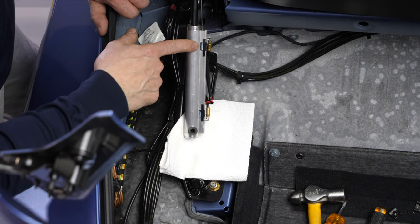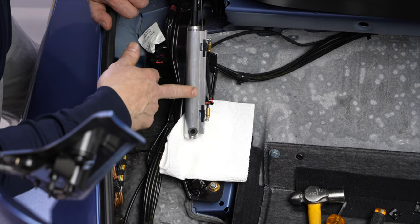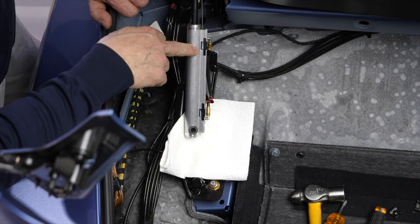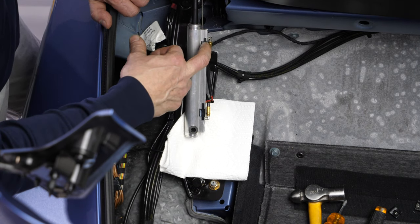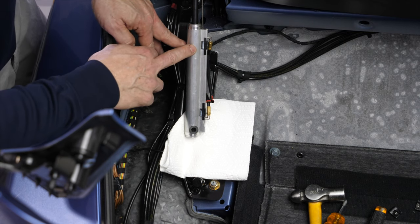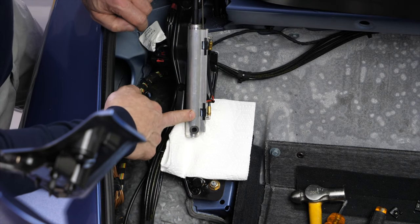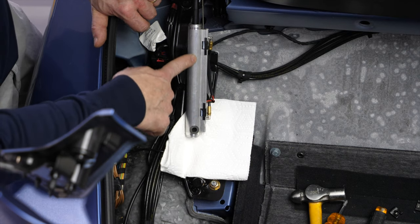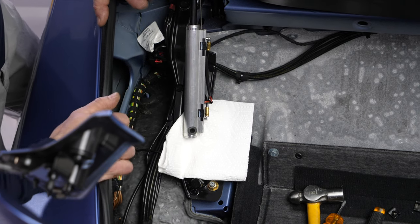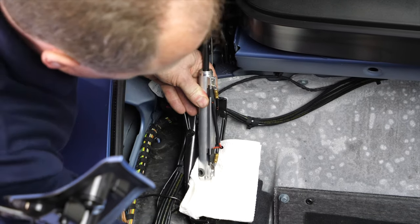These sensors are Hall sensors. They are measuring the permeability of a magnetic field, which, that's a fancy word, really only means ultimately that the magnetic field sensed from this sensor that has a magnet in it changes once the steel piston in the cylinder comes close. That's how the computer knows that the shaft is fully extended or fully retracted. So these sensors practically sense the presence of the piston on this shaft via a fancy method. So now let's take the hoses out.